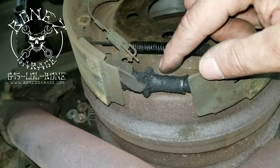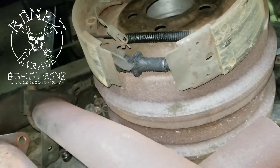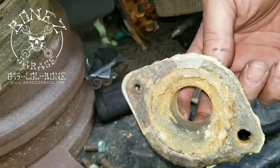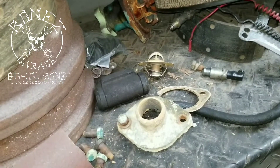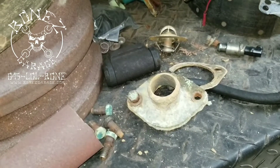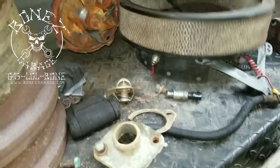You can see it was leaking, and the lower adjuster is totally wet and filled with dirt — so it's just easier to replace them than to try to clean them up and put them back in. Another thing we replaced is the old thermostat housing, and you can obviously see why. We ran some flush through the motor and tried to clean it out as much as possible. We're a little worried about the dirt inside the motor getting into the new radiator, but that's a chance you have to take — we couldn't run the old radiator because it just won't hold water.